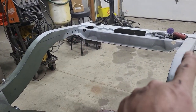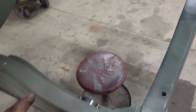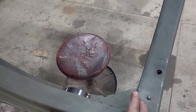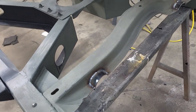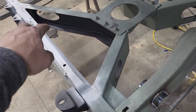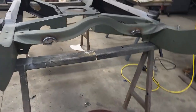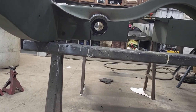There's a brace of course for the shock - it's coilover towers. I started thinking about the exhaust. It's a triangulated four-link, so the upper links are gonna go about one inch above the top of the frame going out to the rear end, and I have at least an inch of clearance. So what I did was I took a piece of two-inch PVC - which is about two and a quarter inches - and I created a line of sight straight through for the exhaust.